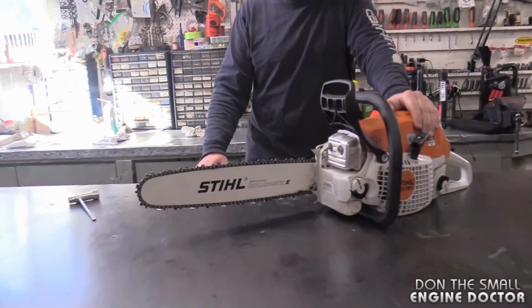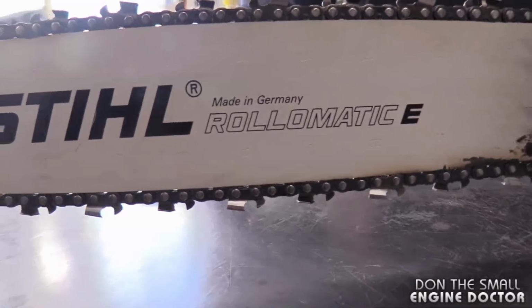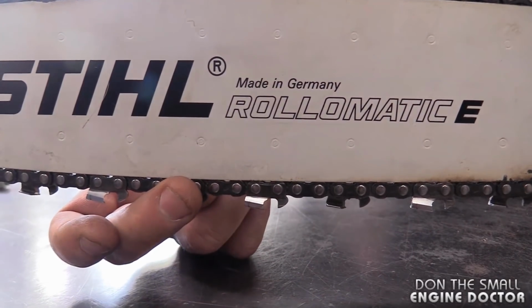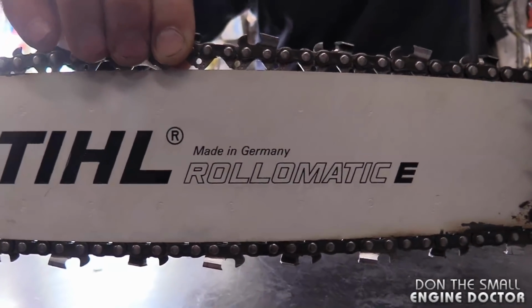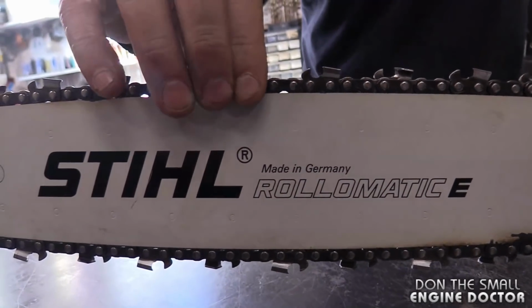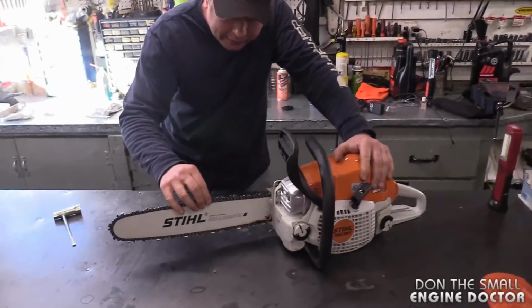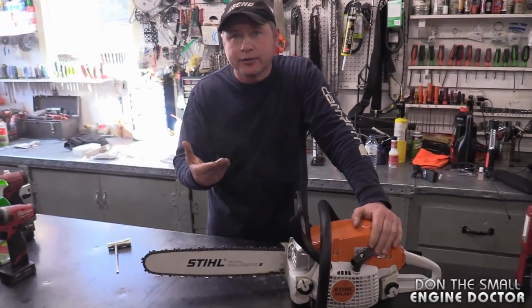Okay, cool. So just the half-inch mark. Let's do another demo here. Now, are you doing half-inch from the bottom or the top, and does it matter? You can go from the top here if you want. Okay, there it is. So I just saw the tip of that drive link. And you know what, guys, a drive link is approximately 1/2 inch in length.